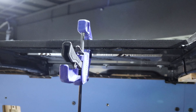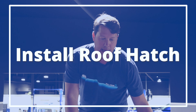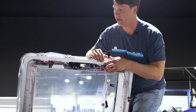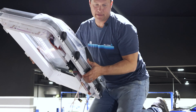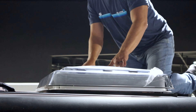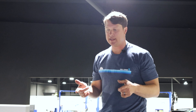The roof adapter has been sealed on and cured, so now it's time to actually install the skylight itself. You want to install the side with the harnesses and the motor towards the front of the van, because the top will open in that direction. If everything's been cut correctly, you just set it in there — fits perfectly — and now we'll go to the inside of the van to clamp the skylight to the roof.